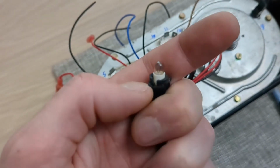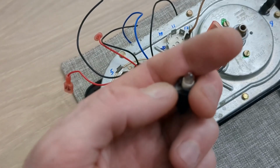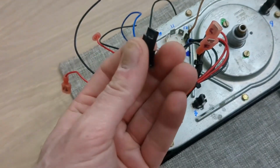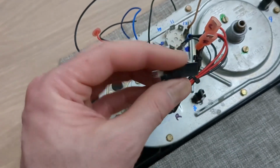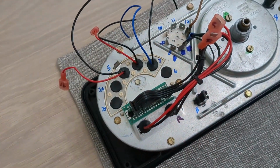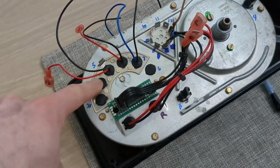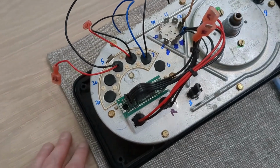Therefore, that front pin here that touches the chassis is actually the ground. The wire coming in from the backside is the positive, and that's what makes the light glow. That's how the bright signal worked. All the rest of them worked in reverse, actually.